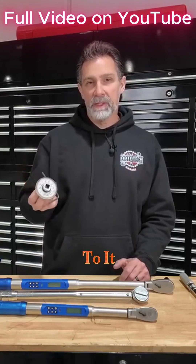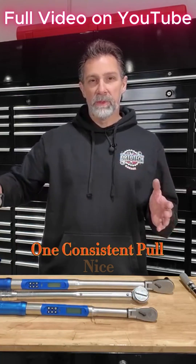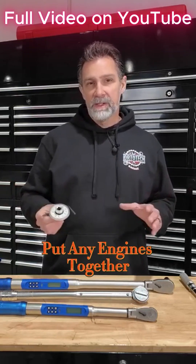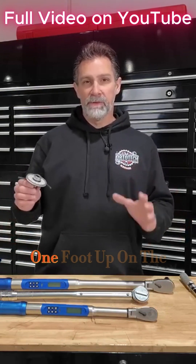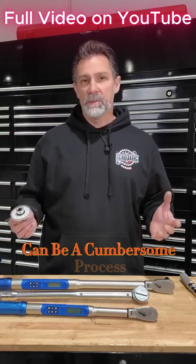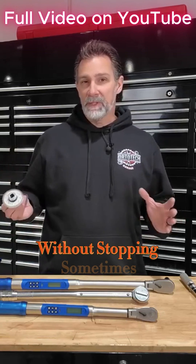This tool has got some drawbacks to it. We can't ratchet with it, and once you get started you kind of need to do one consistent pull, nice and even. Now, if you've ever put any engines together, some of these head bolts are so tight we've got to have somebody holding the engine on a stand so nothing twists on it, and I've got one foot up on the engine stand while I'm trying to twist this thing. It can be a cumbersome process — it's not easy to get a torque angle done properly without stopping sometimes.